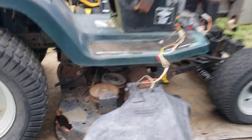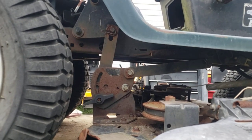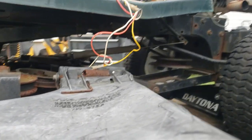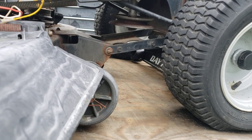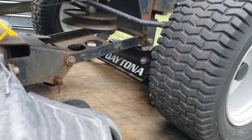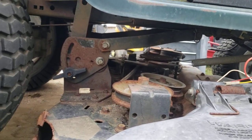This video is actually for a request. These lawn mowers are not very hard to put back together. I've got two arms — a short arm that goes up there with a pin, and this arm that goes up here with a pin. The two pins right here go towards the front. One thing I'll say is it's going to be very difficult to figure out which exact hole it's going to go in, because you do have some options. Back here is very easy — you actually don't even need that second arm, but it does help stabilize it.